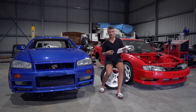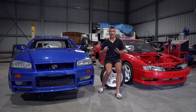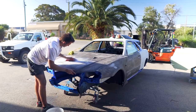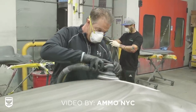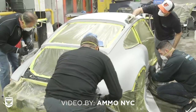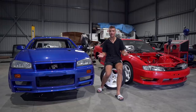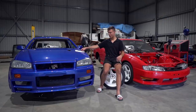The first thing I'd do differently: when the car was in primer and I was blocking it back with 320, I would still block it by hand with 320, but instead of wet rubbing it with 600 I'd just get a little palm sander with an interface pad — a piece of foam — and a dry piece of 600 grit sandpaper. The reason for wet sanding is just to remove the 320 marks. The 600 is not going to get the panel any straighter — it's already straight. So the purpose of the 600 is just to remove the 320 grit marks ready for paint, which is totally doable with the palm sander and saves a lot of time.